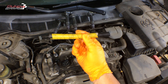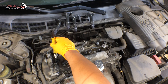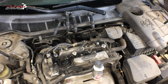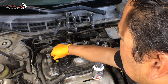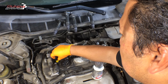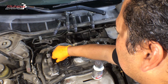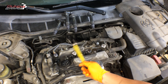Here's another trick my dad taught me: get a six-inch three-eighths rubber hose, put the spark plug into the hose. You don't want to drop the spark plug directly down into the hole — if it lands wrong and hits the side, you're going to bend and change that gap. So just guide it down and you'll feel it when it actually connects. Run it down until the hose starts spinning, and when you feel that, the plug is seated. Pull the hose up and out, then repeat this step with anti-seize and the hose for all remaining three spark plugs.